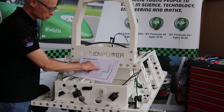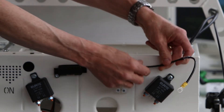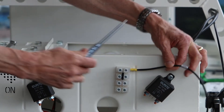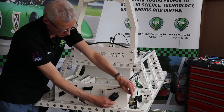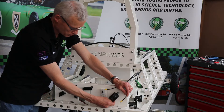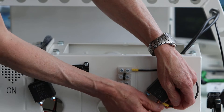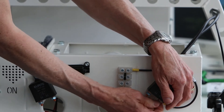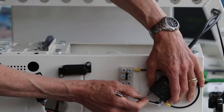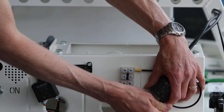The first cable we need is G2G, which has a ring terminal on one end and a little stalk at the other end. The stalk will fit into that first right hand top hole of the connector block, and with a screwdriver I can do up the little screw in there - nice and secure. Then I need to take this ring terminal down to one of the heavy duty connectors on the right hand relay. I'm going to take off the nut and washer and fit my ring terminal onto that terminal, then replace the washer and the nut. I'm trying to keep it neat and tidy, routing it so I can see where the label is, which makes fault finding easier later. Don't over tighten these because you may break something on the relay - just gently tighten.